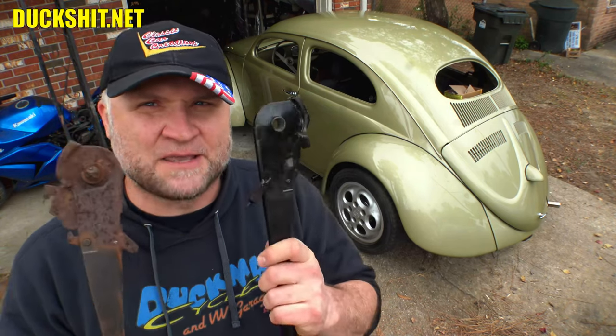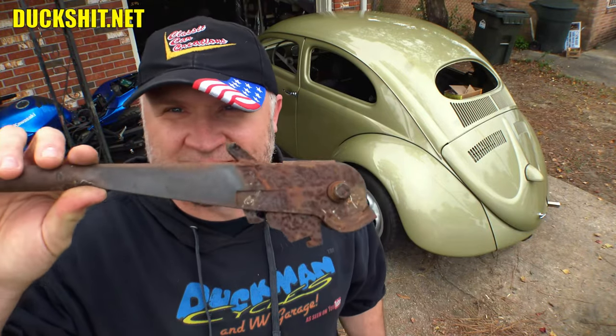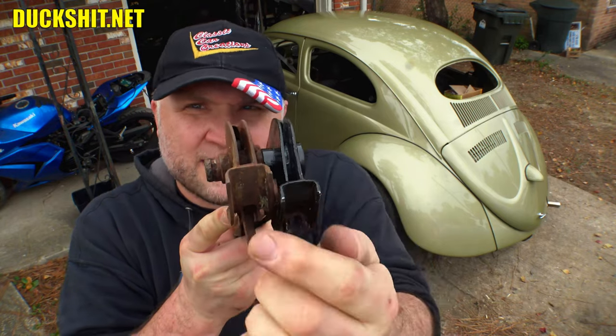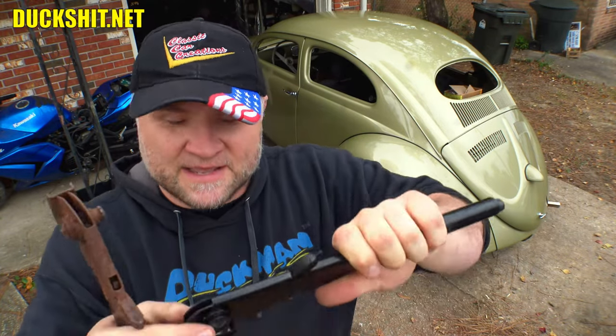So I'm here today to try to get something to work, and I want to make the e-brake work. This is the handle that I painted up real nicely. It used to look like this. I mean, it looked terrible. But the big difference between these two, and you can see it right away looking at the tail end of these, is that the black one that I painted goes a little deeper into the tunnel than this one does. I thought that maybe that had something to do with cable length, and that this would require a longer cable because it's pushing the cable further away from the mounting point, which is up on the top here. So we're going to evaluate that today, and once and for all, we're going to get this thing fixed.